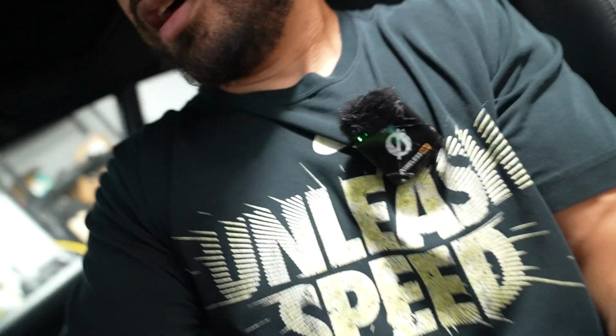So I explained to them that the tender was saying that the battery was charged and was ready to go. They kind of looked at it and they said the cell in the battery is probably dead, hence why it's saying it's charged, but when you go to crank it, it actually just loses all of its power. So we upgraded the battery. Now that's in there, let's give this another crank and hope, fingers crossed, there's no weird noises, there's no grinding sound, and this thing starts right up. I am terrified.